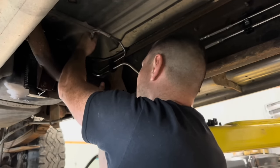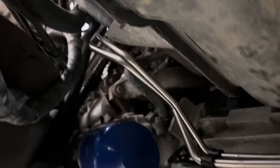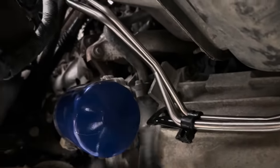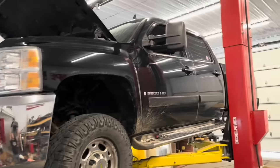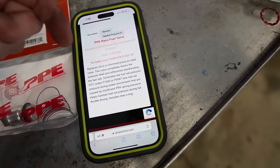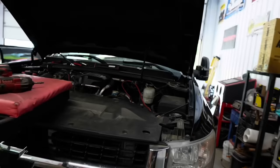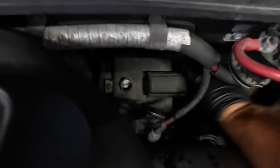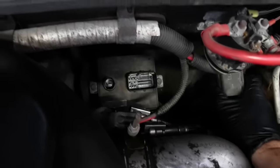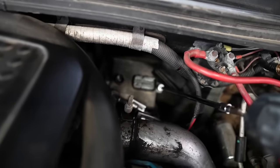Based on what you're telling me, I definitely think you're on the right track as far as inspecting that sending unit and moving forward from there. Now, the injector balance rates are actually at zero and one, so they're like on the money. But it could still very well possibly be the injectors, depending on the return rates. That one truck from way back when I was wrenching - the guy threw all the parts at it - I remember for a fact all his injectors were perfect at idle, nothing. But he still had that extremely high return rate, and we ended up putting injectors in and it fixed all his problems. That guy kicked himself because he spent a lot of money throwing parts at it, and more than likely it was the injectors the whole time.